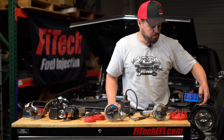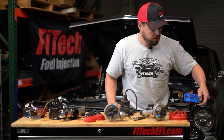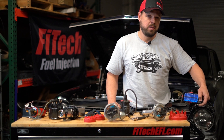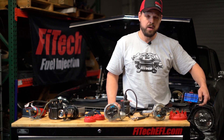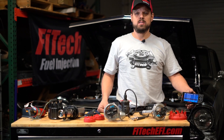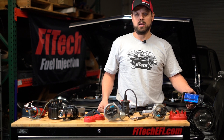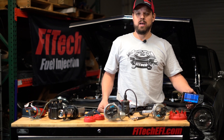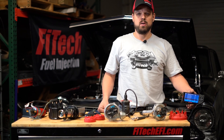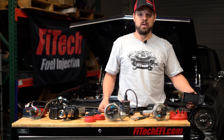If you have a power adder system, there's a boost setting. Boost is based on 180 kPa of manifold pressure, which is about 10 psi. Boost will need to have ignition timing less than your total timing at naturally aspirated 95 kPa max manifold pressure — be sure to set it up safely for your engine combination. An engine dyno is the best way to set up your ignition timing max; if you don't have access to an engine dyno, a chassis dynamometer can be used for full throttle timing, and cruising on the street or dyno can help you adjust part throttle and low RPM points.